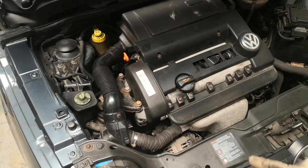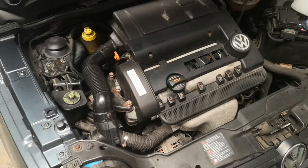Now I've just got to top the coolant up, turn it over by hand to make sure everything's clear and still in time, and then fire it up. I've just topped up the coolant, so I'm going to leave the coolant cap off because I need to re-bleed the system, and I'm going for the first fire. That's spot on — I'll leave it running for the next half hour, top it up with coolant, bring it up to temperature, and make sure everything's alright.